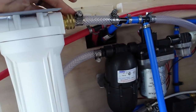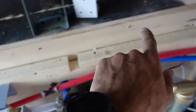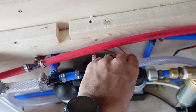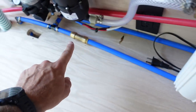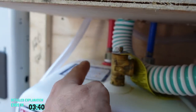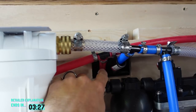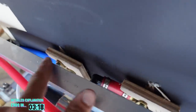Once it passes through the KDF filters, the water separates. Cold water goes to the sink faucet through the wall. Then the cold water hits a T, giving it a choice: it can go to feed the shower gray tank as part of the recirculating shower system, or it can go through a 12-volt valve all the way to feed the water heater. After the cold water goes through the water heater, it comes out the hot side via red PEX tubing and again has a choice — hot water to the sink faucet or on to the shower.